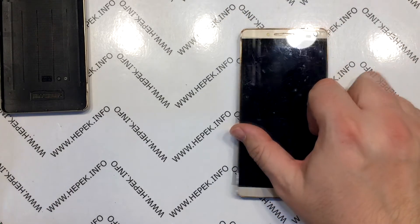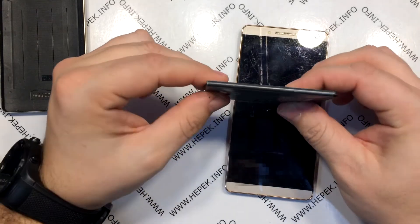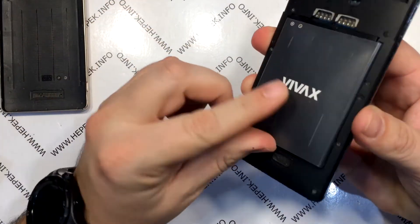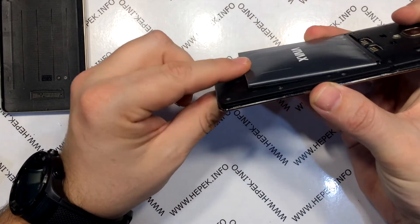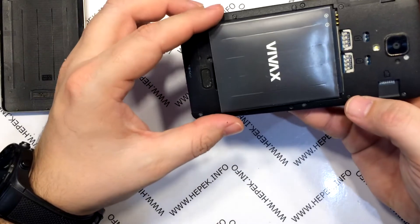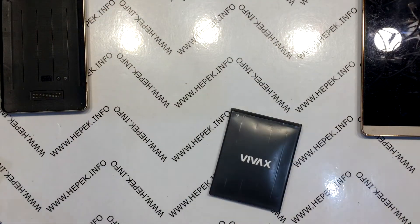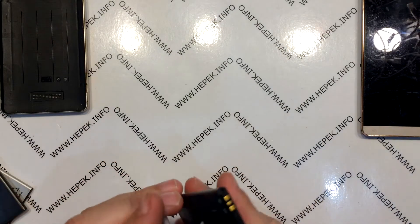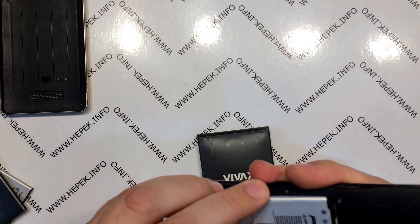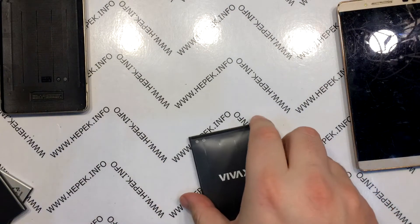You will notice that this smartphone does not have a battery. This is because the original battery is inflated and can no longer fit in the smartphone — theoretically it could, but that would not end well. In this video I want to show you how to solve this issue. We must first find a battery that is the approximate size of the original battery. It is important that it is not larger than the original one. First I checked the battery of Samsung Galaxy S4 mini. It could be used, but I look for a better one because I have a larger selection of batteries available.